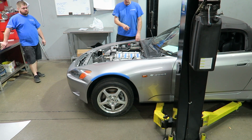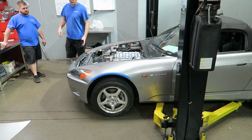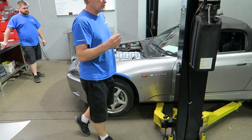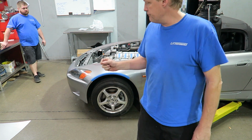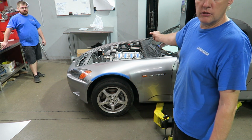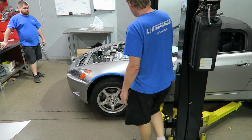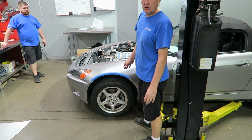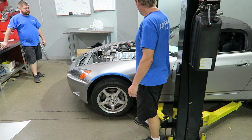Once the engine's out, we're going to be putting in the new clutch, the new bleeder line. It's a remote bleeder, right? For the clutch? Yep. A remote bleeder brings the bleeding to a different point, brings it higher up. Also makes it easier to bleed. We usually tuck this around this area. A lot easier to get the air out, so we don't have a problem with that.